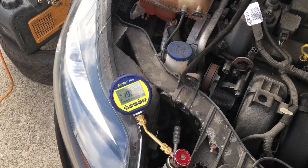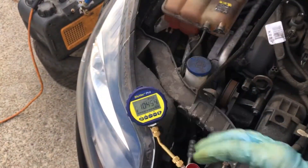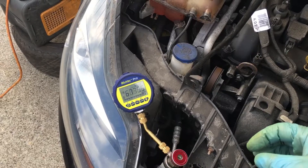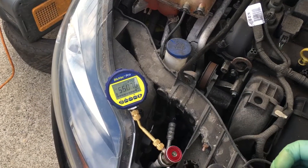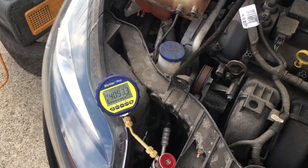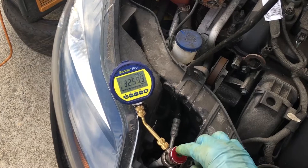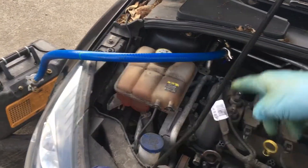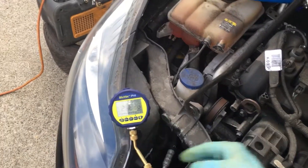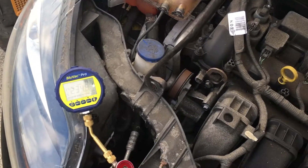We're getting down there pretty rapidly. Too bad I didn't do video editing and bring in an AC machine from another shop — you'd probably see it take several minutes longer before it even starts to register with a normal Robin Air, Bosch, or anything like that. So now we're reading the vacuum here, not at the pump or the gauges. If we were reading at the gauge it would have started reading within the first 30 seconds and would already have gone way down, but over here it didn't even start to read yet.